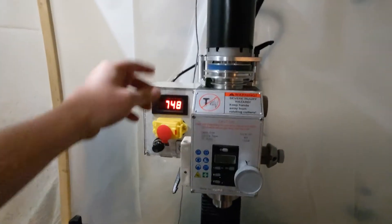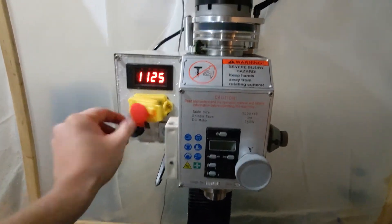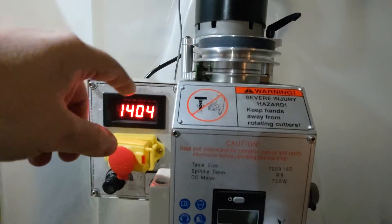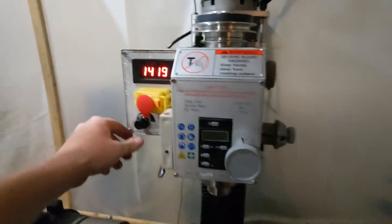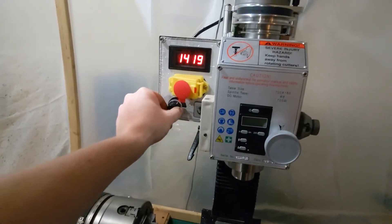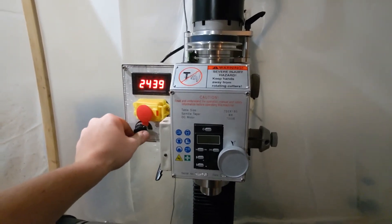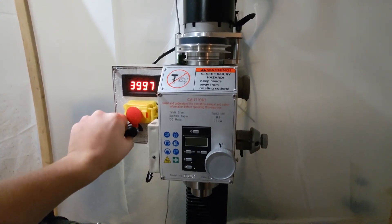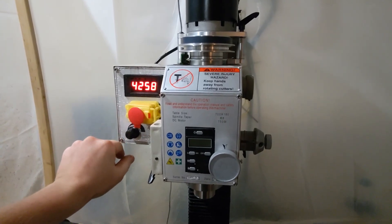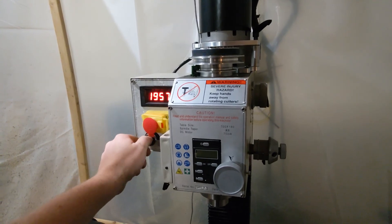It's the next morning. I went ahead and flipped the motor and installed the belts — everything looks like it's back to functional par. Had a little issue with the RPM meter: put it too close to the shaft, it wasn't reading properly and got marked up, but it's just plastic. Reading 1400 RPM now; before the upgrade the machine would go about 2200 RPM. Sounds very nice, not too loud. All in all, I would say this is a success.